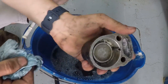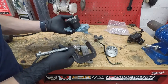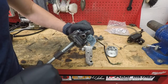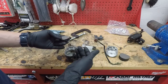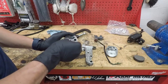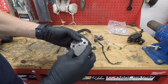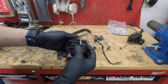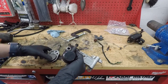We've got the brake pads, the back caliper plate, the mounting bracket, and the piston. Now I'm going to clean up the caliper and get it ready for reassembly. First things first, I'm going to compress the piston — it compressed pretty easily, that's all the way compressed. Now let's install the new brake pads using mechanics gloves so I don't get skin oils on the new pads. This side with the little nylon washer thing goes on the piston side — it's a nice tight fit. The other side goes on the other side with a little cotter pin to hold it. New brake pads installed — now we can reassemble the caliper.